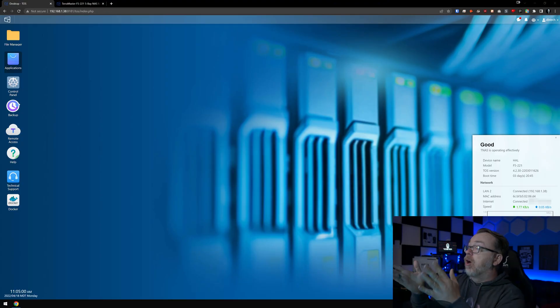So the first thing I did was I threw 2-terabyte drives in it. And then I was like, let's see how much RAM it's got in it — let's throw some more RAM at it. Here we can see that it says it's got a maximum supported memory of 6 gigs, with 2 gigs soldered onto the board — you're not changing that, that's permanent. However, it also says support up to 4 gigs in the other slot. I was looking around online and saw that other people had had better results than just 4 gigs. So I threw an 8-gig stick in it, and right here you can see that I've got 10 gigs of memory in here. I'll leave links to all of this in the description down below.